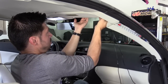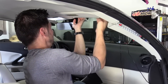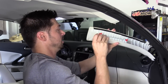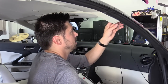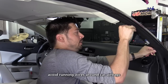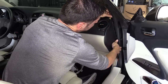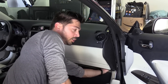Next you want to go ahead and hide the wires behind the molding. This is tedious but fairly easy. These right here pop off really easily — just pull them out. Same thing goes for the bottom, it just pops out. With these plastic pieces, make sure when they fasten back to the car frame that you don't put the wires in the way where the clips pop into the car frame. You can hide the wire behind the weather strip and push it behind those clips so it doesn't get in the way of putting the molding back on. Shove the power cable under here and use zip ties to mount it under your glove box.